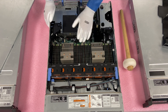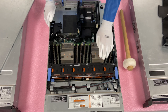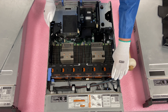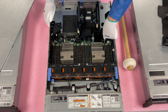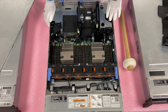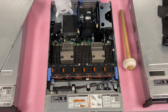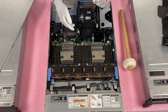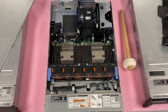So we're going to identify some of the general parts: CPU one, CPU two, and there are 24 DIMM slots — these are all your memory modules. This is going to be all of your fans. This is going to be your backplane cable, which comes all the way over to your RAID cable. Here's riser one, riser two, and riser three for all your PCIe slots. Here's your NIC card. There are dual power supplies under here. In general, that's the heart of the system — the motherboard and the green PCIe board that you see.